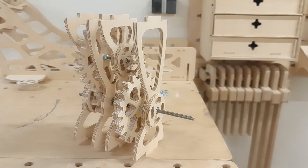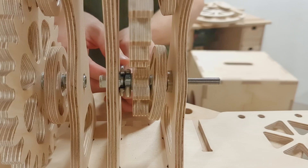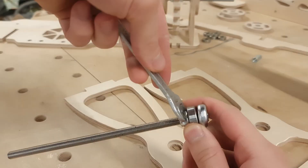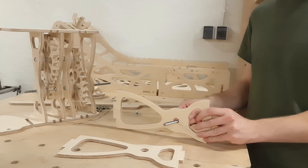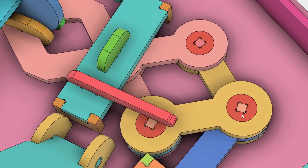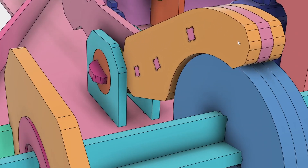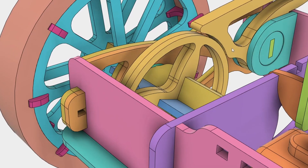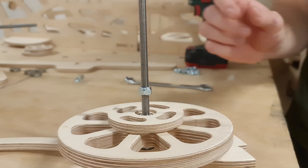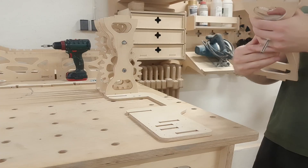Once the gear module is assembled, we can attach it to the go-kart's frame components and align the gears properly. This required loosening the flange nuts that are holding the gears, making the adjustments, re-tightening the nuts and re-securing the gears. Before we can secure the gear mechanism between the go-kart frame, we have to assemble the brake module. As with most of the other mechanisms, the brakes have evolved quite a lot with every prototype. For the first cart, we used complex scissor mechanism brakes which didn't work at all — there were too many moving parts. After the first failed attempts, we tested out different handbrake options and simplified the design as much as possible. Now we have to secure a brake disc between two ball bearings and the back wheel support components.